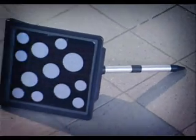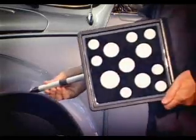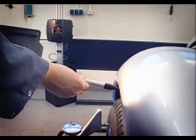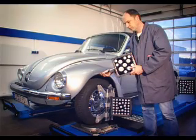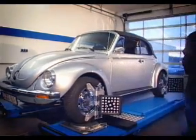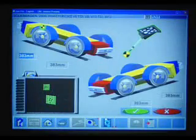The optional accessory tip, target image pointer, a mobile reflector, is designed for time-saving ride height measurements. Simply touch the ride height reference points with the tip and the readings are automatically transferred. Ride height measurements are fast and error-free, especially when performing alignment measurements in accordance with manufacturer's specifications.